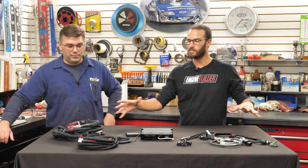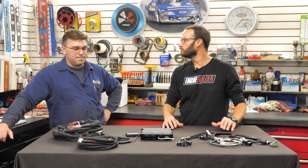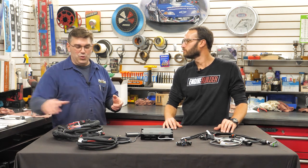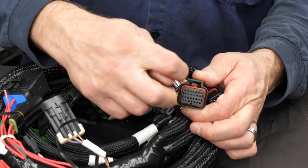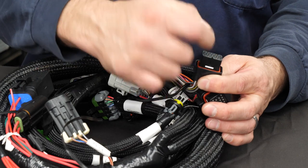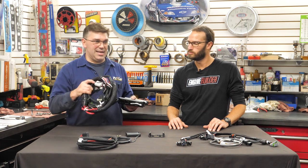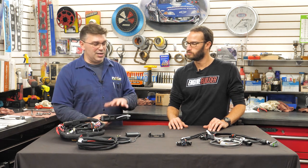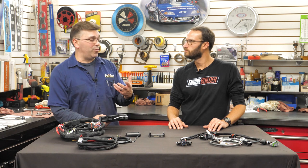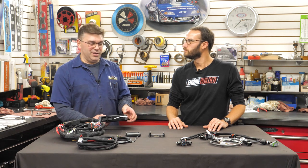If anyone out there is seeing a lot of wires and wondering about the setup — is it pretty straightforward getting this thing all outfitted on an engine? Yeah, if you look at how they do the harness in general, they've got everything very well labeled. The main header connectors that plug into the ECM — whether it's this Terminator X platform or an HP or Dominator — they all use the same connectors, so you can use this harness with another ECM of theirs. From a setup and wiring standpoint, the directions are actually in the software, but the paperwork they give you is pretty straightforward. A novice can generally figure it out.